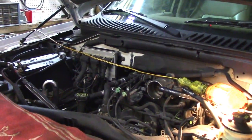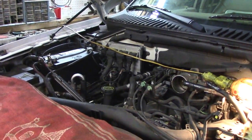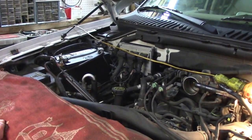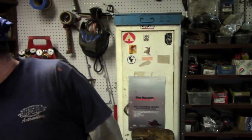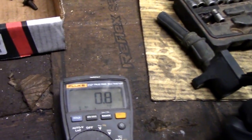You can also test the coil pack with a volt tester that does ohms. Look up the specs online because they're all different — some you test through the coil magnet, some from where the spark plug connects. Or if you don't want to mess around with it, take it to AutoZone and they have booklets telling you how to test it. I'm going to take cylinder 5 off as well and do a comparison — measure the resistance and see if there's any difference.